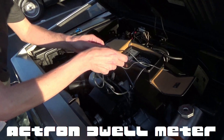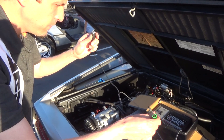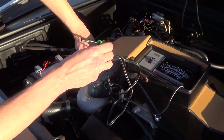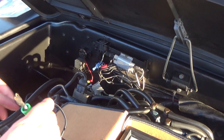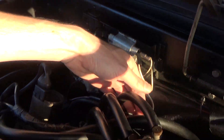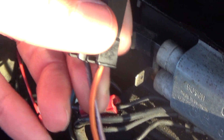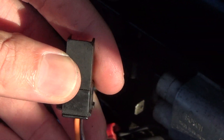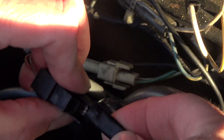There is a positive and a negative lead. Negative goes on to the engine ground — I like to use this bracket for the AC. The other positive lead connects to the engine. The orange wire on this plug here was formally connected to the diagnostic plug that is no longer really needed, so you can just connect those two terminals together.